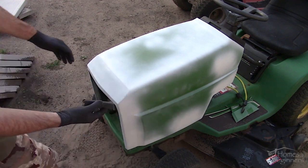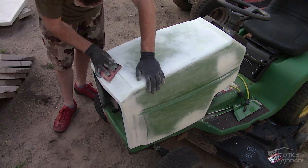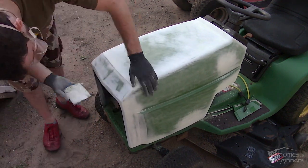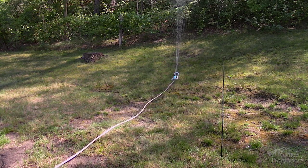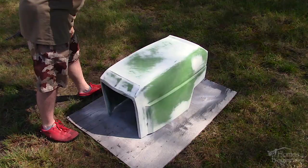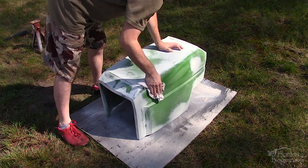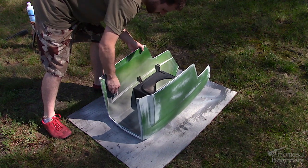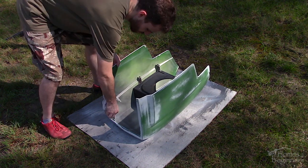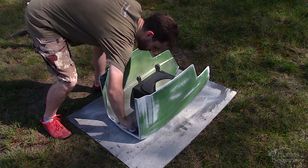I left the hood for the next day until sanding. Using 400 grit sandpaper again with a backing pad, the whole hood is sanded removing any overspray and orange peel left behind from the primer. Work in multiple directions ensuring the whole hood is sanded and you have an even surface. While finishing up the hood for paint, I watered the grass where I'll be painting to keep any dust down so there's minimal risk of any debris being blown into the wet paint. Clean off any sanding debris with a clean cloth, then finish wiping down the surface with a lint-free cloth and isopropanol alcohol — both the inside and outside of the hood were cleaned. This is a milder form of cleaner compared to the wax and grease remover so it won't attack the primer, which may potentially cause issues for the paint. Allow the cleaner to evaporate for about 10 minutes.